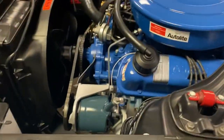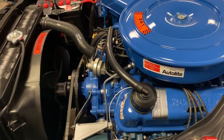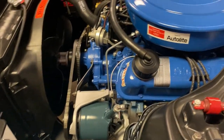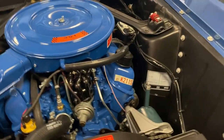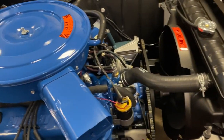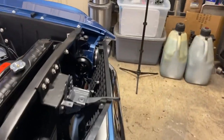Anyway, the engine's in, power steering's working. I hooked that up last. There was a drip coming off the control valve. No, off the power steering ram. I tightened one of the lines, so maybe that's gone away. Engine runs fine, holds good oil pressure, and charges. I'm running the electric choke off the green-red wire off the voltage regulator. I found that out the hard way. Everything's grounded, everything works fine. All the lights work. I will tell you a story.